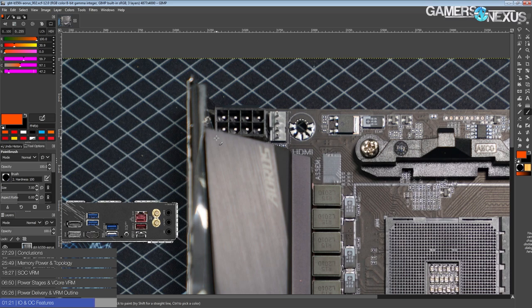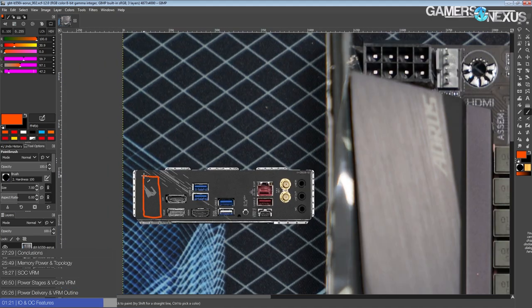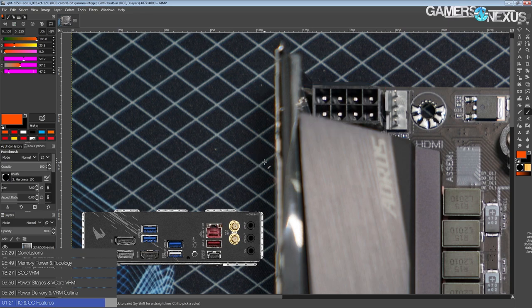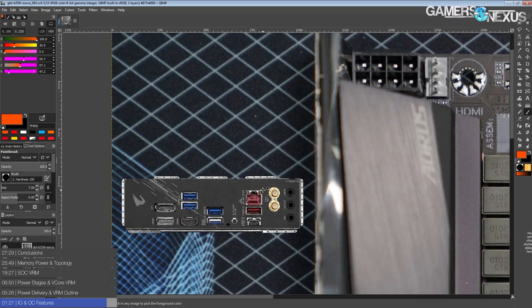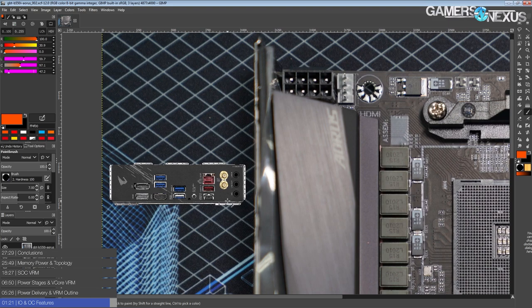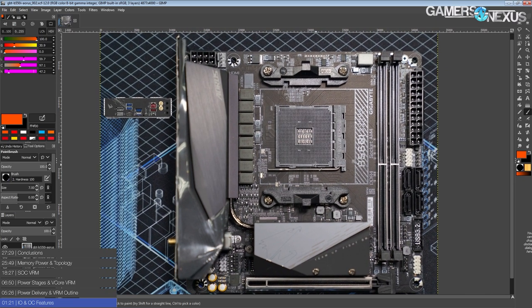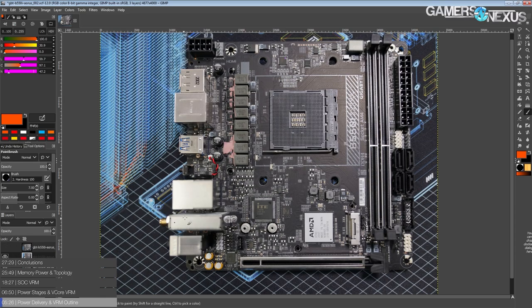The main issue is that the silicon dies are very small and therefore the heat density is really high, which is why the CPUs are so hard to cool — but they don't really pull a lot of power. The single 8-pin is not going to limit you in overclocking in any way, but it is part of the reason why we don't have a stack of USB ports, because that's where the 8-pin lives right behind that section of the rear IO. ITX board design decisions: if we want to power the CPU, we can't have USB ports.